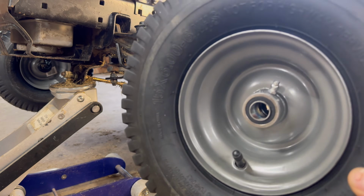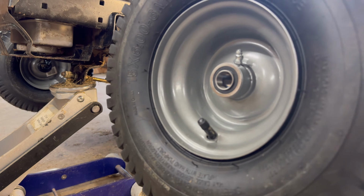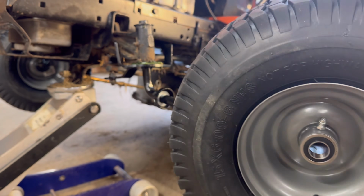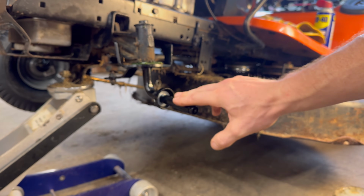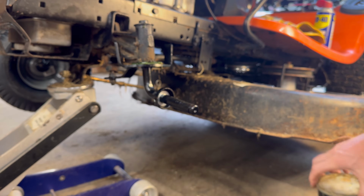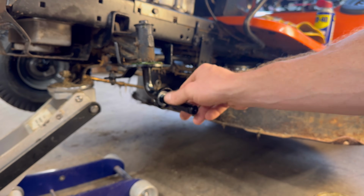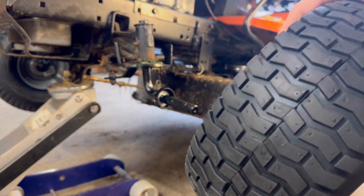Now you're going to notice on this wheel I've gone ahead and replaced the bushings with bearings. That is an easy upgrade, as we talked about. I'll go ahead and put that link below. But when you do that, if you've upgraded the bearings, you don't need to grease this. But if you're going back with the bushings, go ahead and put some wheel grease on there. I'll put a link down below because it's going to be sliding on here and you want that to be well greased.